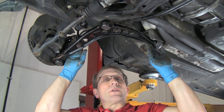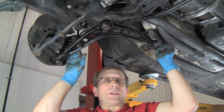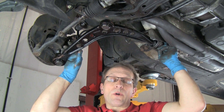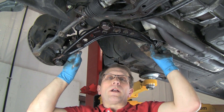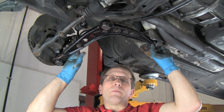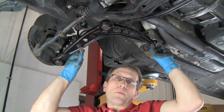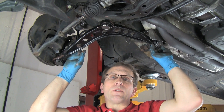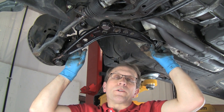This side is fully complete. So you can see replacing the complete control arm or just the bushing — we could have done just the bushing with the arm on the car — it's relatively easy to do. You do need to have the car up on at least jack stands; ramps won't work for this. And our special tool for the bushing removal and installation is well less than the cost of labor for having someone do the job, and you've got the tool for the next time. Hit your like button if you've liked what you've seen, send us some comments, and don't forget to visit our tech blog at blog.bavauto.com. Like us on Facebook, follow us on Twitter, and visit our online store at bavauto.com. Thanks for watching.